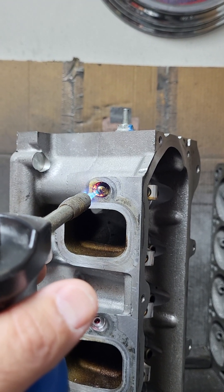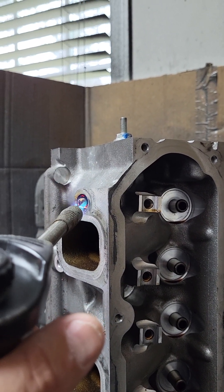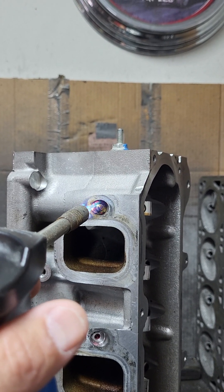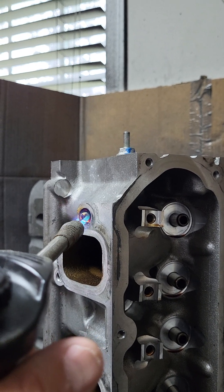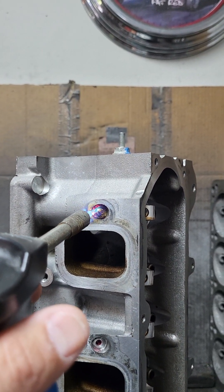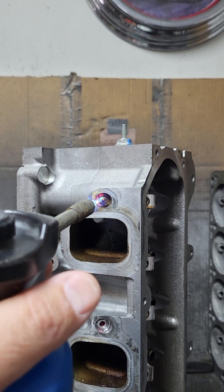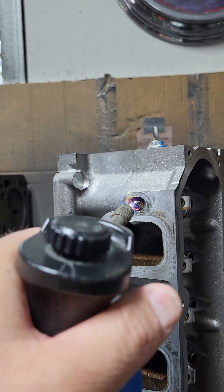If the stuff hasn't melted by five minutes, I'm just not doing it anymore — this is stupid. All these great suggestions yesterday, but we're the ones that are too stupid to melt Loctite — except the Loctite is not melted. Coming up on four minutes, direct flame blue heat as suggested with the Bernzomatic. But you guys are right — it melts right up. 200 degrees, comes right out — this is easy work. Four minutes.